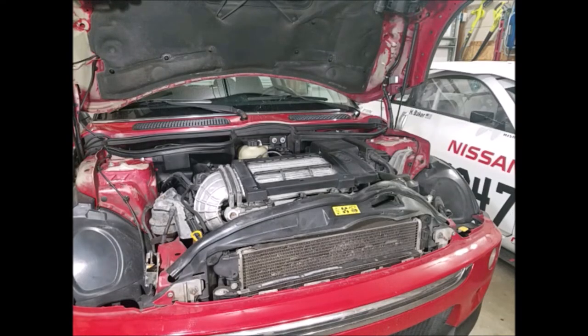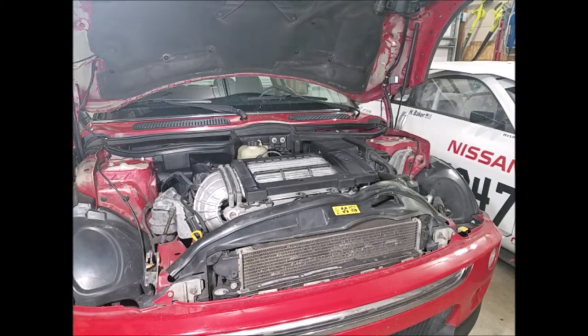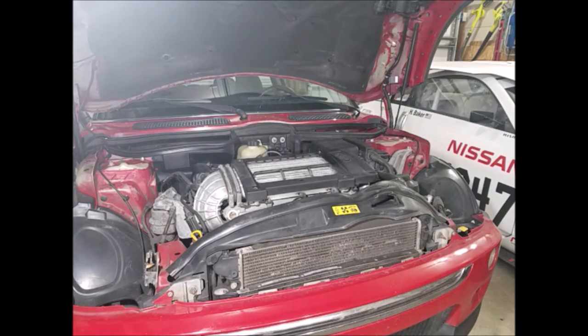With that, our first steps of maintenance are done — new oil, new spark plugs, new air filter, and a topped-off power steering system. Eventually we'll have to get into the cooling and the brakes; the brake fluid looks horrible so I can't wait to flush that out. The only thing left is to start the car, make sure everything runs properly, and let it run for a second to get oil into the filter so we can check the oil level properly. If you have any questions, drop them below, hit that subscribe button, and I'll see you guys next week.